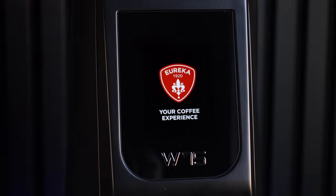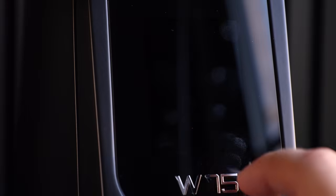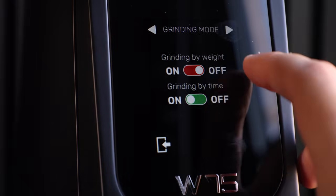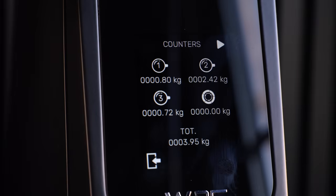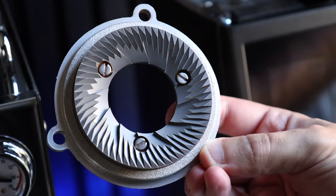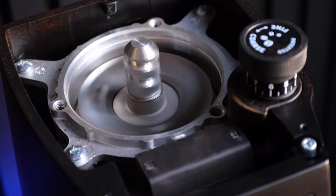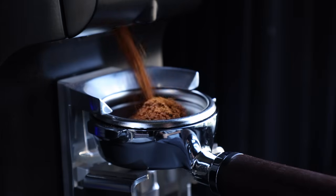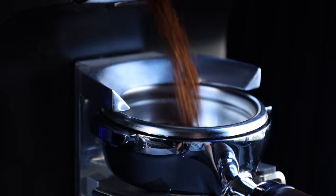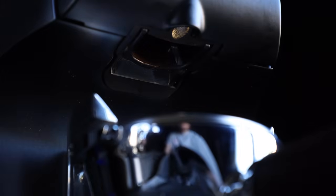On the face of the grinder you have the main control touchscreen, which has three adjustable setting slots as well as a press-to-grind option. The setting slots can be used in both grind by time or grind by weight — that option can be changed in the menus, which also display total grind volumes, options for cleaning and calibration, and other screen settings. Inside the W75, doing the grinding is a pair of Eureka's own hardened stainless steel 75mm burrs, powered by a 430 watt motor spinning at 1700 RPM. That power paired with the wide diameter burrs puts out a respectable four to five and a half grams per second. The grinds go directly into your portafilter on a fully adjustable fork that even has its own little spotlight that turns on when actively grinding.